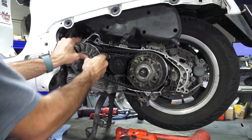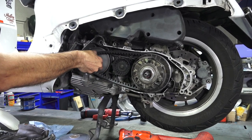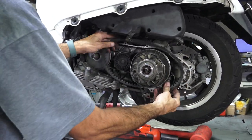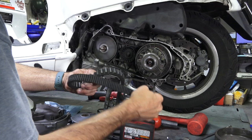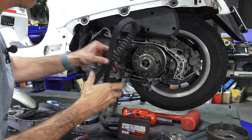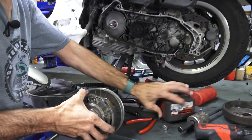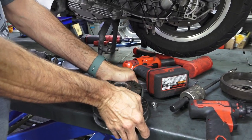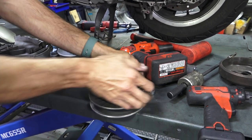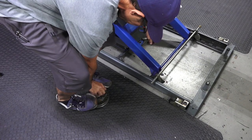To take it all apart, it's nice and easy when you have power tools. But when assembling, I always use the factory tools to hold all the pulleys. I'm not sure if he's at the service interval — the belt looks okay. It's not falling apart like my BV350, if you saw that video where the belt was coming apart. So here's the clutch assembly — see how that's all rocking. It might need a new clutch. I'm going to do this caveman style, take it apart with my bare hands and see how this thing looks.